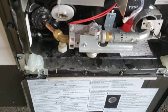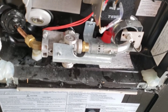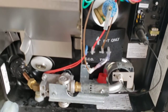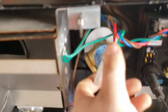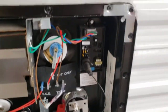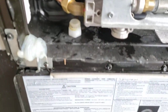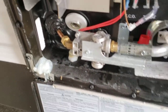Put that plug in, and as soon as you hook up water this will fill up and be ready to go. I always recommend draining it after every trip — water that sits in there will start to get stagnant after a couple of weeks, even a couple days really. Before you pull the plug out, pull your pressure relief up like that; water will squirt out and that's okay. Once it stops coming out, snap it closed, then take your plug out. If you neglect to do that and you've been running your water heater a lot, there's a lot of pressure in there — if you try to take that cap off you're going to get a hot bath and that cap might get shot across the campground.